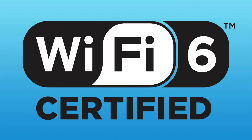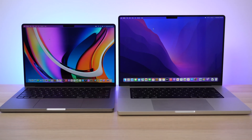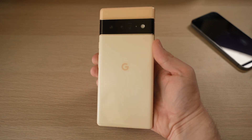Wi-Fi 6 is a term you're probably familiar with. It's been available in the latest Apple products like our iPhones, MacBooks, and iPads, as well as many other devices for the past few years. However, Wi-Fi 6 was just a stepping stone to what many were considering the true upgrade to home wireless networks: Wi-Fi 6E. Because unlike regular Wi-Fi 6, which is still limited to 2.4 or 5 gigahertz networks, Wi-Fi 6E opens up an entirely new spectrum of 6 gigahertz network, promising faster speeds, more bandwidth, and less congestion for this new wavelength being reserved for the newest 6E capable devices.